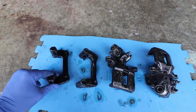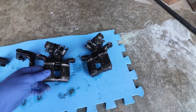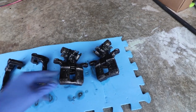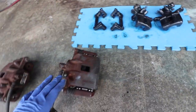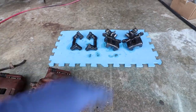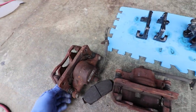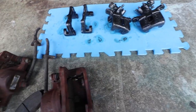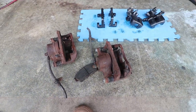So here are the brake calipers, guys, that I was mentioning earlier. These have been nicely cleaned and have been sitting for the past few days, but as you can see, we're finally able to see part numbers and symbols again on the brake calipers, which is nice to see. There was a lot of rust on here and it's finally gone, so I'm moving now on to the front brakes. These ones just have surface rust on them, nothing compared to what I was dealing with on those guys. They're not going to have to go in any solution. I'll just hand brush everything down with the wire wheel, get them cleaned up and prepped for paint. These are just going to be a flat black color, not a gloss, but everything else in that wheel well area is mostly gloss, so I'm trying to change things up a little bit. We'll see how it goes.